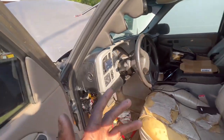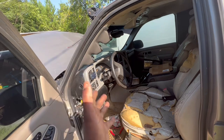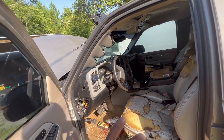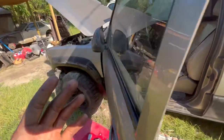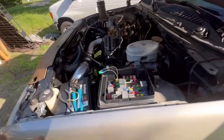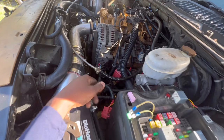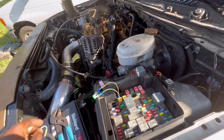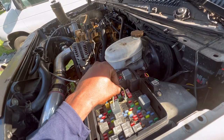And right, I think I have to do a segment swap because I don't think the truck is going to start, because they don't know if it's in park or neutral. I did repin the PCM down that way. I did jump from 30 and 87, and the truck started right away, so that's what we're going to do.